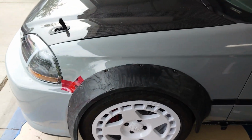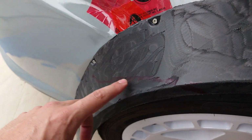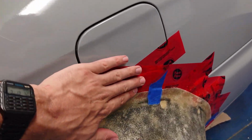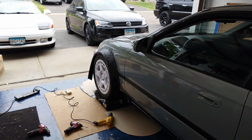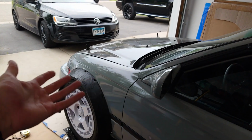Now we got the flare mocked up on the car. All our little screws are in. I even went ahead and drew some little lines here where I want to make some cuts. I'm gonna apply some of this red tape here. This is real good stuff. Of course, I'll put links for everything in the description down below. We're gonna be applying this tape to the body of the car, so when it's time to lay the fiberglass, which is coming up pretty soon here, we won't have any problem with the resin or the glass sticking to the body of the car and damaging our paint.